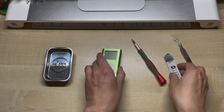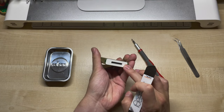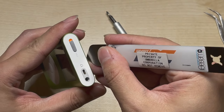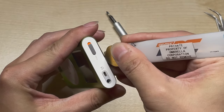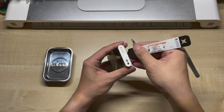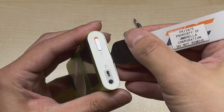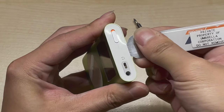We'll begin by opening up the iPod Mini. The Mini is held together by end caps on the top and bottom, and these are connected using glue as well as clips. So using a pry tool, we can just very slightly insert it into the gap between the back casing and the end cap. We don't want to insert too far inwards — just 1 or 2 millimetres — because there are electronics behind it, and if you insert too far we can damage the internals. Now we just pry upwards slightly and then peel it like this.